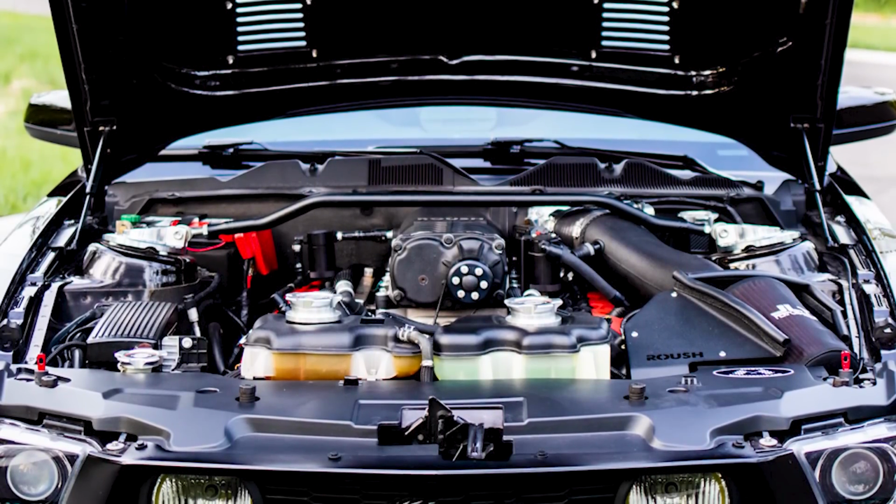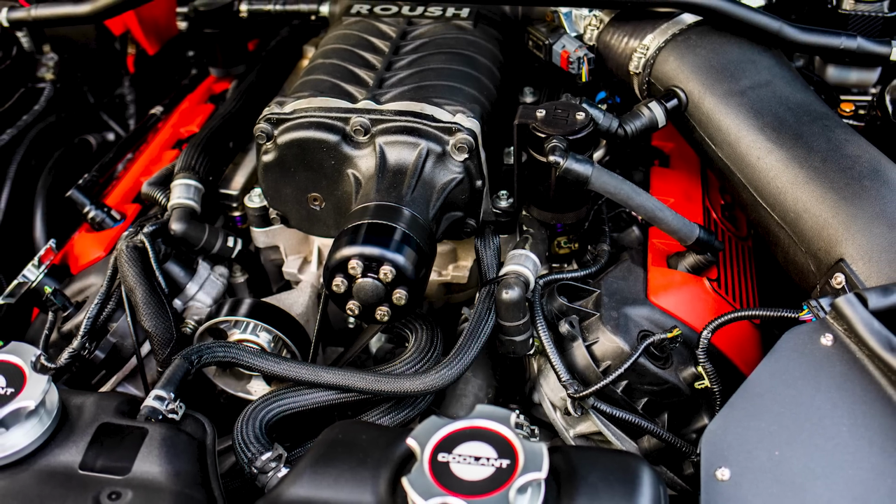It sounds like you got some big plans in store, right? Tell me about what you just did with your pulley size. I was at a 79 millimeter pulley. I went to a 75. I'm still on 93 octane. I do have a tune for the 79, and I just put the 10% overdrive pulley in as well.